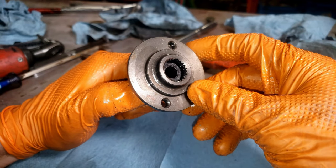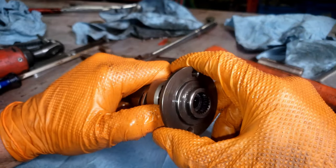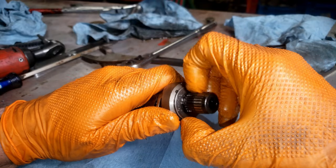The sprocket flange is a press fit on the cam and it is keyed, as you can see right at the top. Make sure you put that back on correctly. Beneath it you'll find a washer.